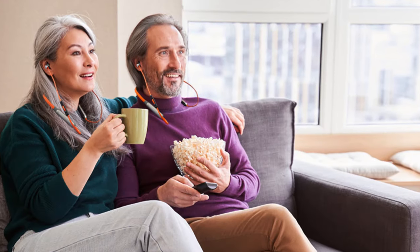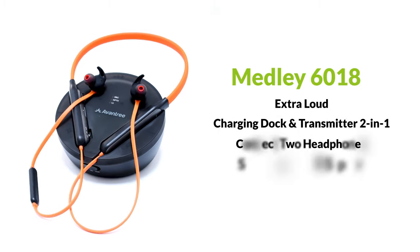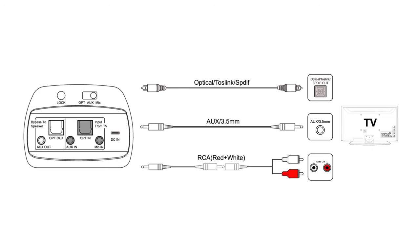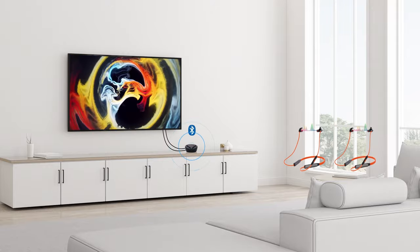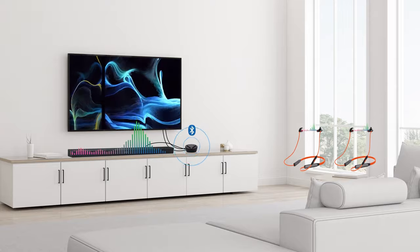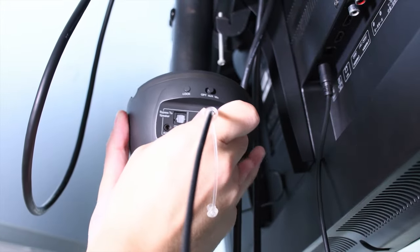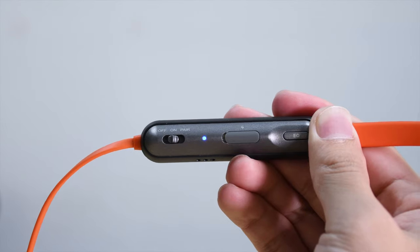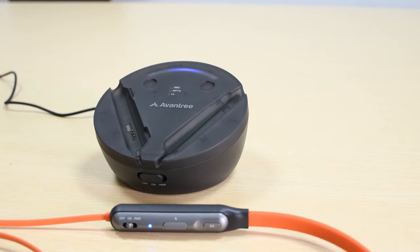If your TV does not come with Bluetooth, or if you'd like to connect two headphones to your TV at the same time, you'll need something like this — wireless headphones that come with a transmitter. These are compatible with any TV that has an audio output port: digital optical, aux, or RCA. They usually let you connect a second pair of Bluetooth headphones, and some even work alongside your soundbar or stereo AV receiver. All you have to do is connect the transmitter to your TV's audio output port, power the headphone and the transmitter on, and play away. It's that easy.